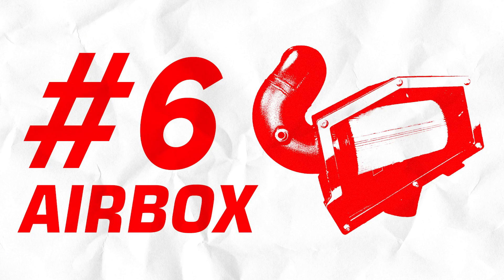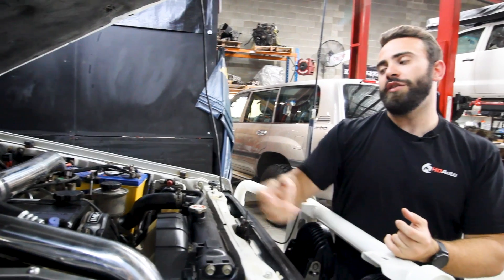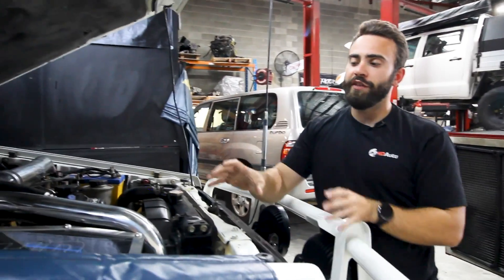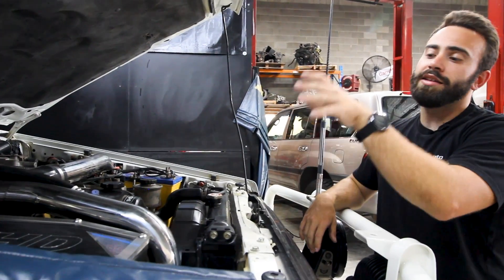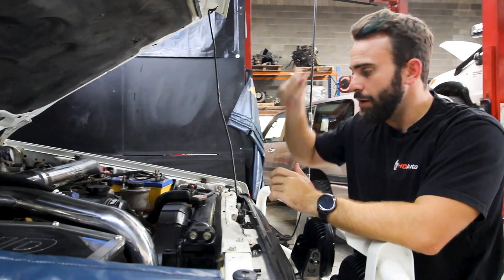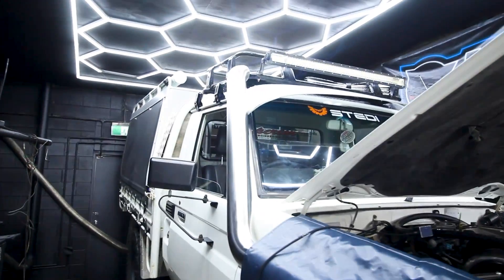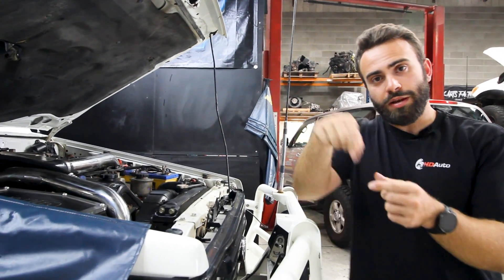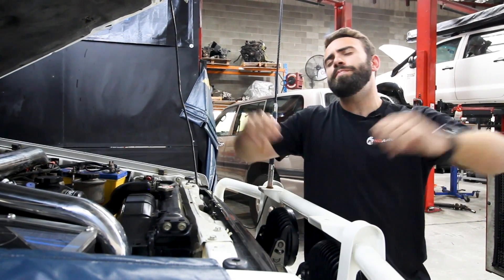The stock airbox is fine when paired with stock injectors — you can't outrun it at that level. But if you upgrade your injectors, you'll be out of the stock airbox before you know it. This vehicle runs a massive pod filter — a paper-style filter. I would take this thing up to Cape York through all the bulldust without hesitation. The airbox also has a water trap down low, so if you take in water from a stainless steel snorkel — which is very common — it has a factory-style duck-bill drain and a sump for the water to collect in before draining out. It also includes a complete four-inch intake pipe all the way to the turbo.